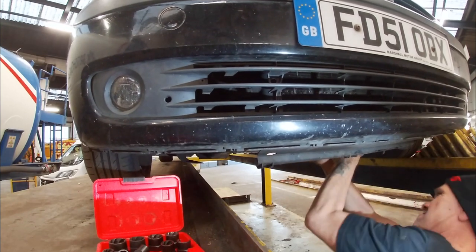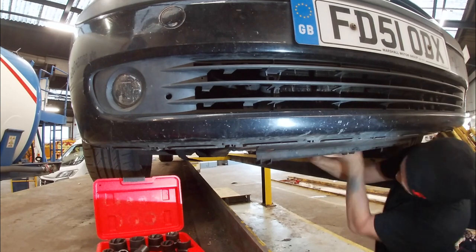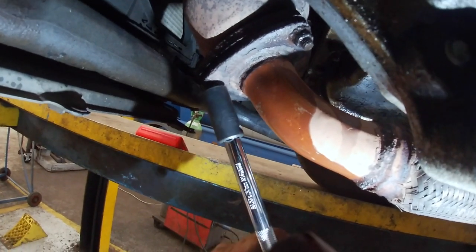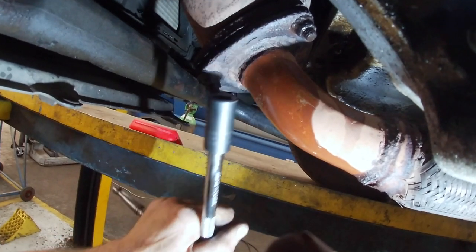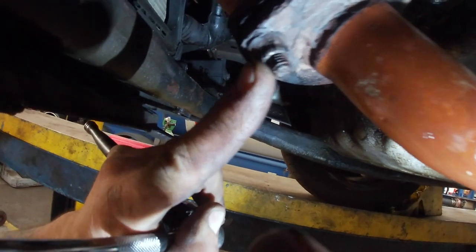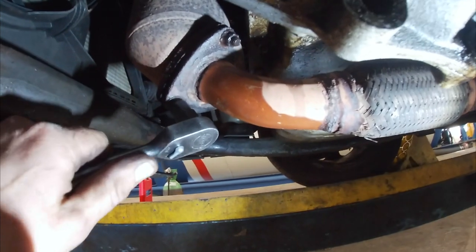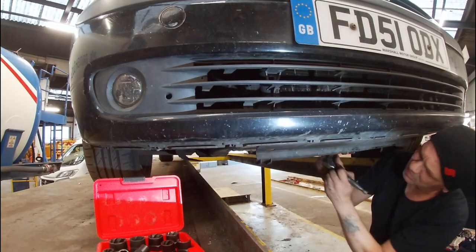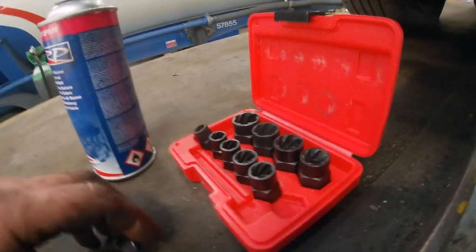It's easier on the ramp to remove an exhaust bracket or exhaust pipe. I'm having problems with a certain area of this exhaust — the nuts here, because they are rounded off, basically. They're a bit small. I've got a 13mm socket but I think that is about 12. Some people hammer a socket onto those, which is not good because you can end up splitting a socket. So there is an alternative, which is a bolt removal tool — it's for rounded nuts and what have you. I've removed three, and that was done very easily and successfully with this tool.